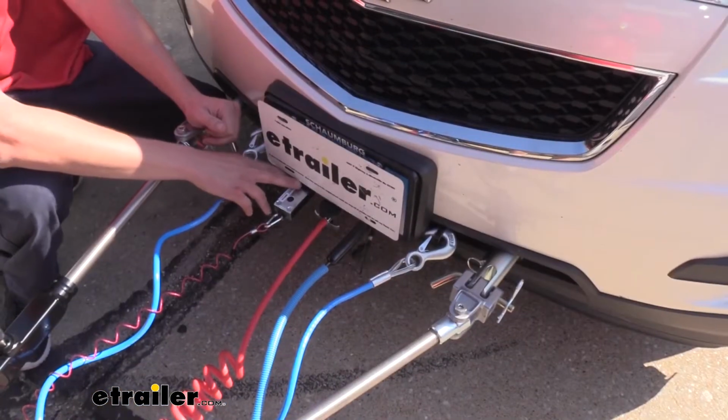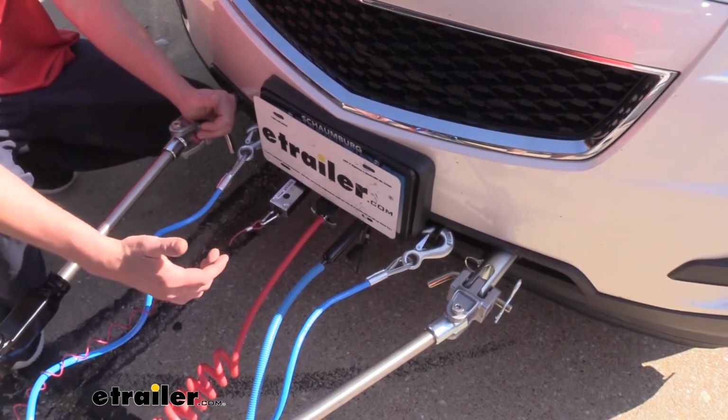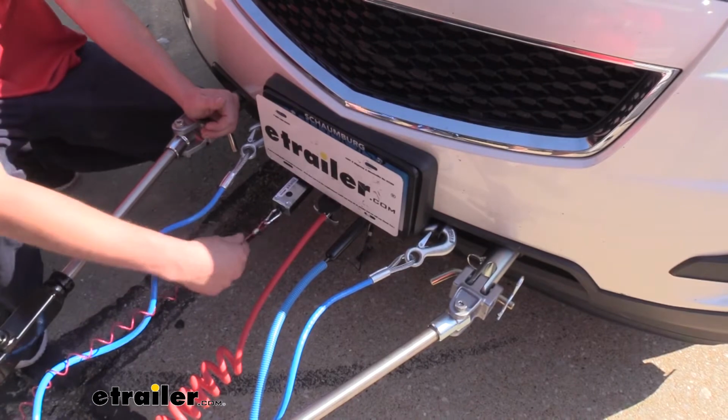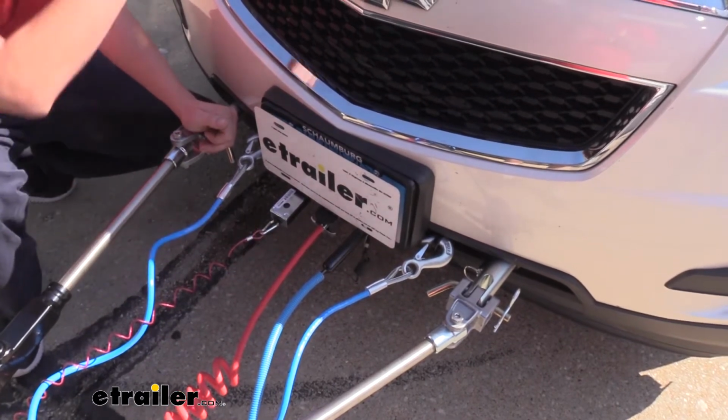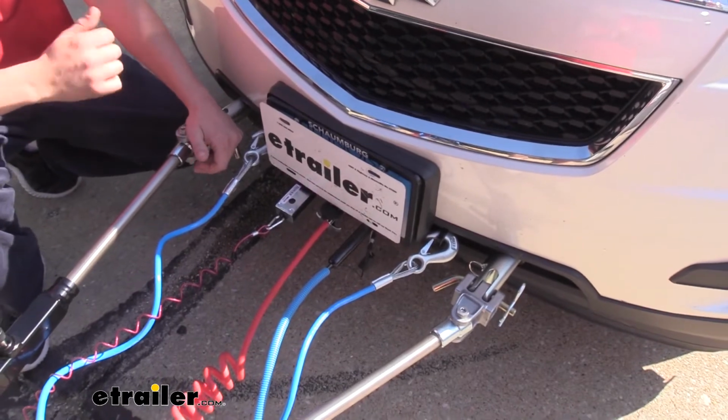Along with your braking system, you'll receive a breakaway switch, which is installed at the front of the vehicle, and in the event of a catastrophic disconnect, the cable will pull the pin, which will activate our actuating cylinder on our brake pedal, applying the brake to help our vehicle come to a safe stop.